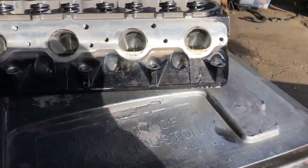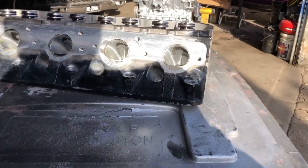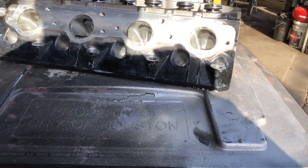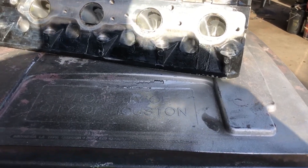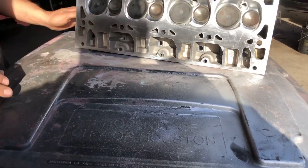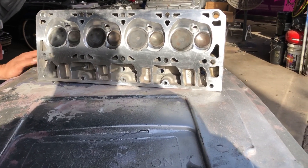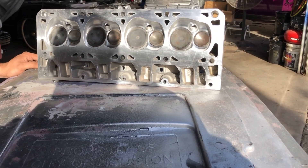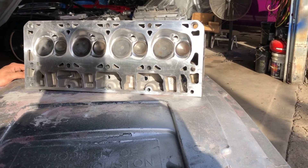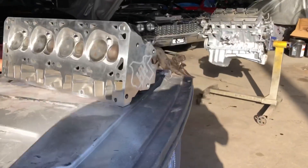When I take these home, I'm going to lay everything out on the table and shoot a video in my garage. As far as caring for these, is there anything I need to be mindful of? The biggest thing is just keep them out of humidity so they don't start to rust on your valves. He checked all the valves, made sure none of them were burnt, made sure nothing's bent. He also does a valve job. They've been completely reworked — hot tanked, cleaned out, made sure there's no shavings inside. Because you never know what happened to the original motor. Just a safety precaution to make sure we don't get any damage.